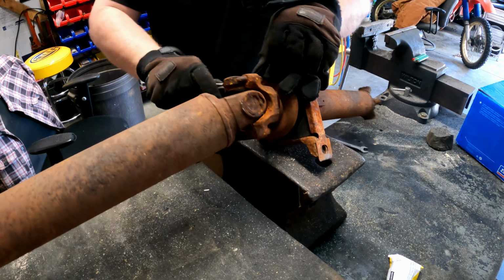Well, I'm down to the carrier bearing, and I don't think there's anything wrong with it. It's nice and quiet. It slips and it's rubber. I don't think that's anything right there. I think that's just the rubber isolation damper. But it's quiet. And this U-joint up here feels really, really good. It's fairly new too. Most of what's under here's got, I don't know, just a few thousand miles on it. Probably less than 10. Anyway, I drove it a lot, but it was local here.